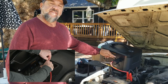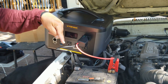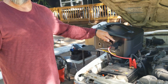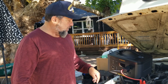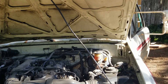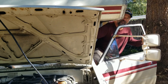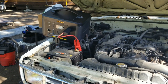Notice the solid green light on the adapter — that means your connections are okay. If it's a blinking green light, your battery is 100% dead and it might not start. If it's red blinking, your connections are on wrong. I'm going to go ahead and start the vehicle. This is a Toyota EFI motorhome — it's been sitting for a while, so let's see if this thing starts.